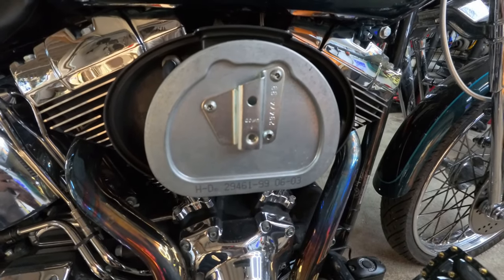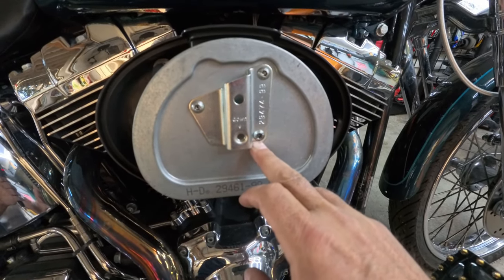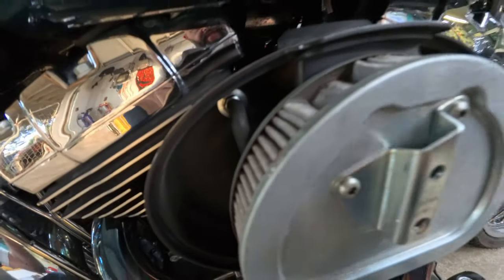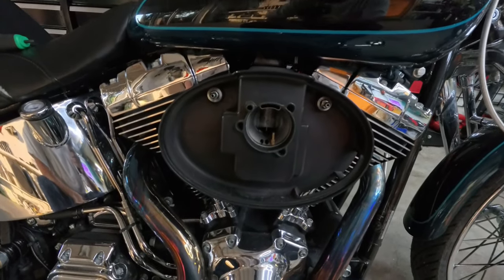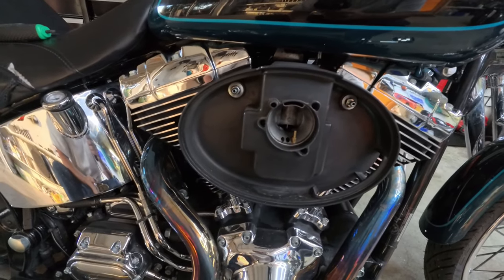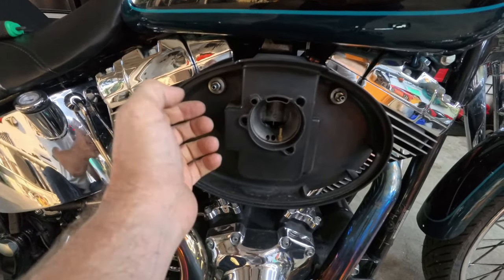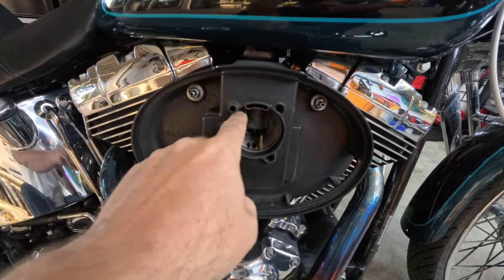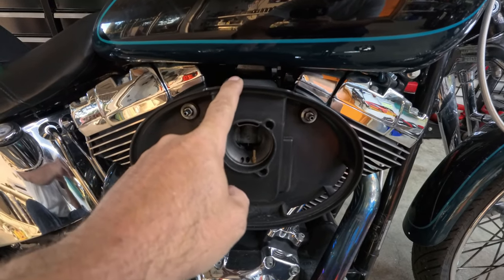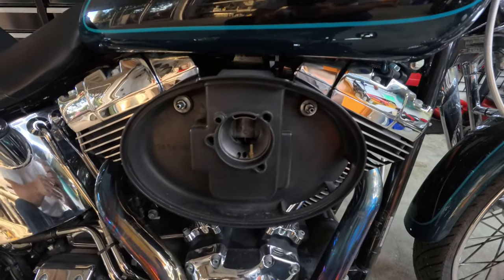So now I've got these bolts here, and I think those are going to be T25s as well — three of those — and then this will come off, and we've got our breather hose there and there. We'll back those out and figure out what's behind that. With that off, it does expose the actual banjo bolts, the breather bolts, and that's a 7/16ths — both of them. We'll just crack those loose, and then this should come right off. We'll probably have to scrape away any remaining gasket that goes between this and the carburetor itself, being careful not to knock our carburetor free from the intake, because it is just pressure fit in there, and these banjo bolts do help hold everything into the bike.